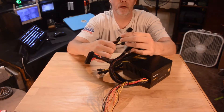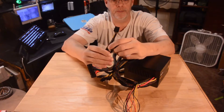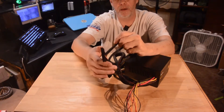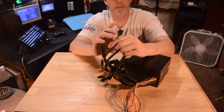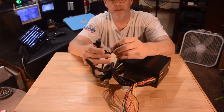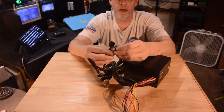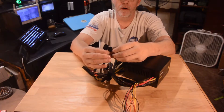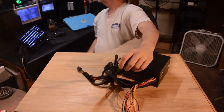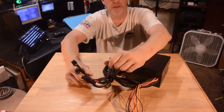Then you have, on most of them nowadays at least, ones labeled CPU. These are the ones that go to the top or side of your motherboard, depending on where it's at. Some of the newer ones have them down at the side where your 24-pin plugs in. The older motherboards had 4 pins, then they went to 8-pin. Some have 6 — they went from 4 to 6 to 8. And now you've got some that are 8 and 4, and some that are 8 and 8. Mine is an 8 and 8, with 2 power cables going to the top of the board.